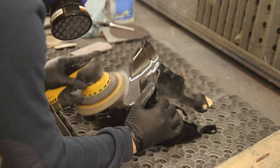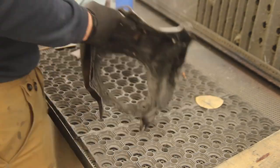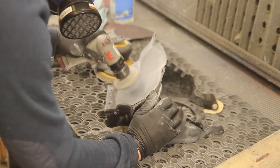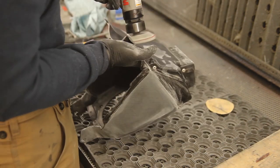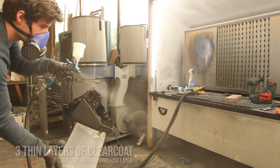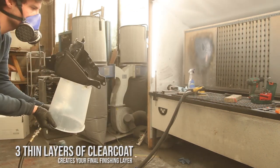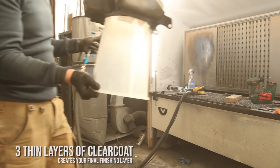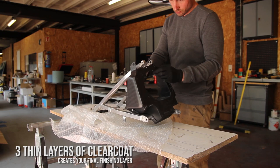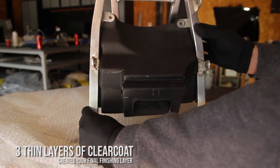You can see there are still some small defects — it's not fully mirror-finished yet. The advantage of clear coat is that it's easy to sand: start with 600 grit, then proceed to 1000 grit before finishing. You could also polish it, but make sure not to sand through the clear coat or you'll get marks. Here I'm applying the last layer — a matte finish. I could go gloss as well, applying two or three thin coats depending on the manufacturer's data for the product.